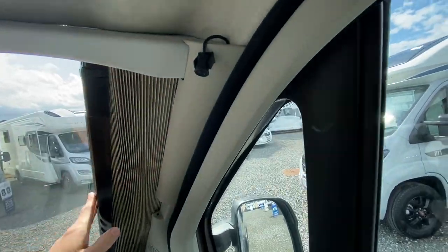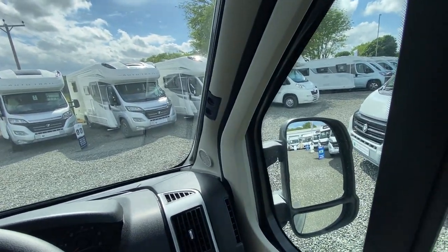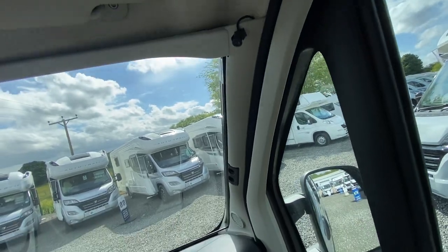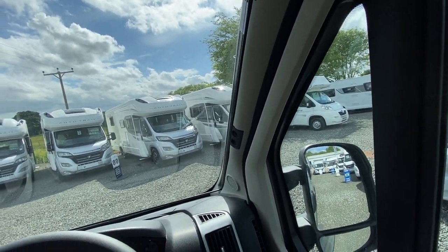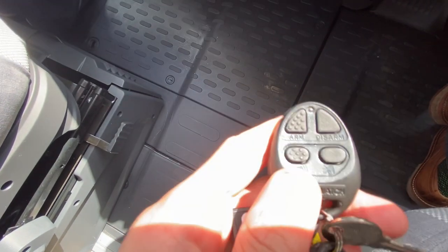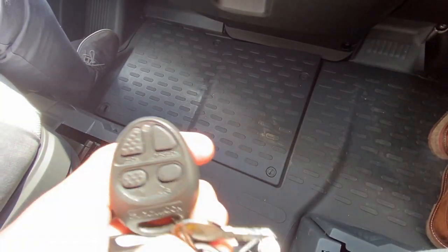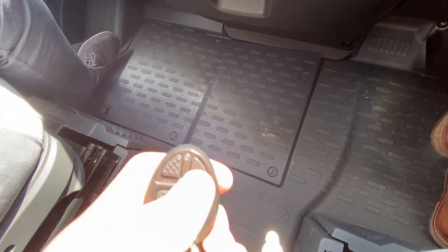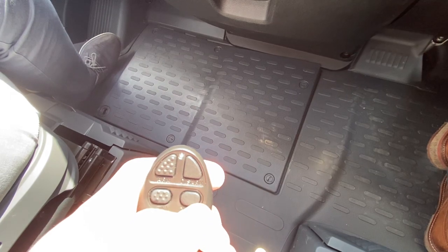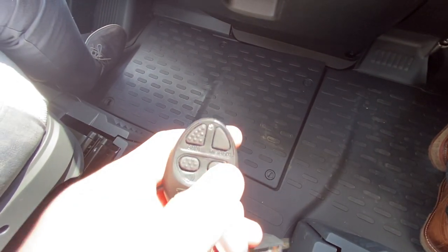To operate your alarm: these are your ultrasonics. To arm the alarm, lock the vehicle as normal. If you want to arm it with dogs inside and disable the interior sensors, lock it and then on the small Autowatch remote you've got arm, disarm, sensors and bonnet release. Press disarm twice after locking the vehicle — that turns the ultrasonics off. It will then arm the doors: bonnet, two cab doors, sliding door and rear door, but will not arm inside the vehicle, so the dogs can move around without setting the alarm off.